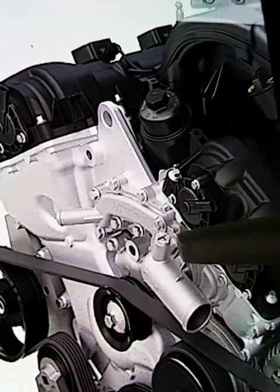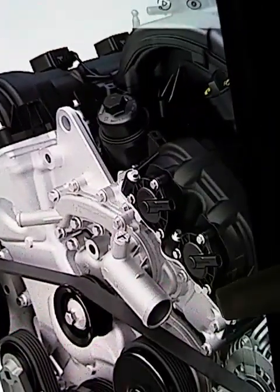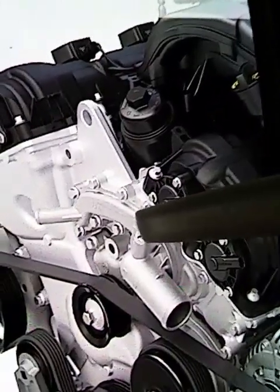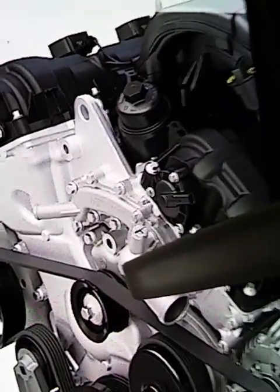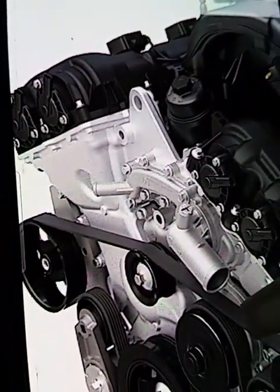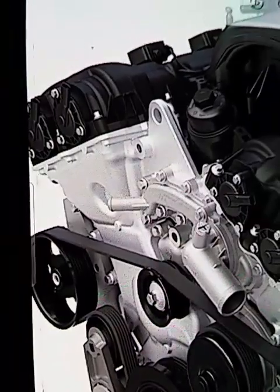That's for the thermostat. That's the bleed screw. And then right here, with that heater hose on it, is the crossover pipe, and that hooks underneath the thermostat, and it feeds water from this head to this head. On most cars, other than the new generations, that's all plastic, and it fails. And so does that little screw right there. And as David Pike says, there's a little piece of forged imprint that goes bad too. This comes with a genuine thermostat, I can't think of the brand. I have one. So anyway, that's the OEM maker.